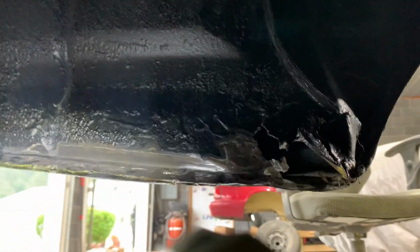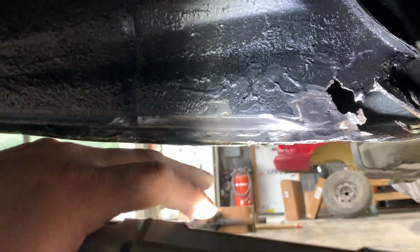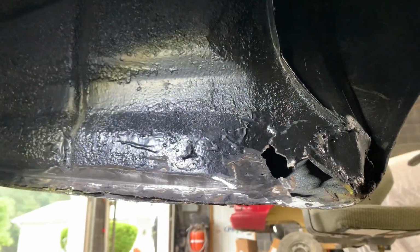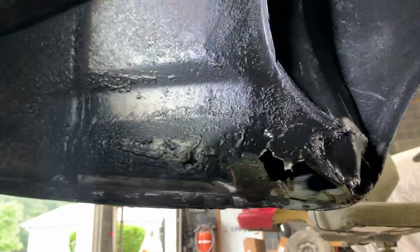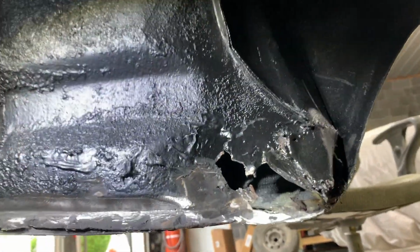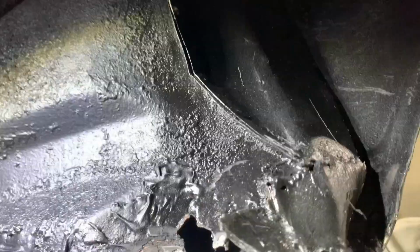and even trying to get it to go where I want it, it's not closing up the gap very much, and I think it's because down here at the bottom the pinch weld is holding the quarter from actually moving. It wants to just put it in a bind. But when I started to come down here to mess with the pinch weld and cut it loose so I can move it where I need it to, I found this cobbled up mess.